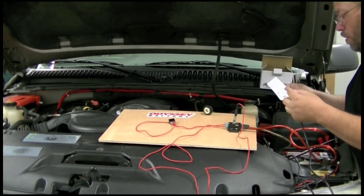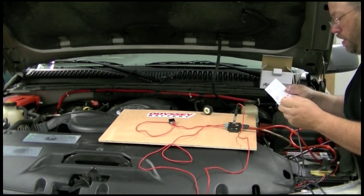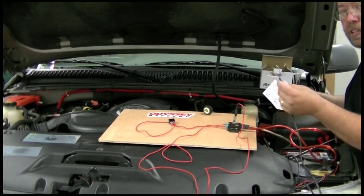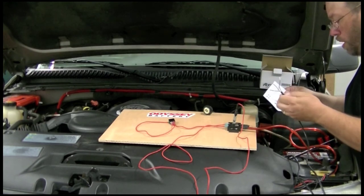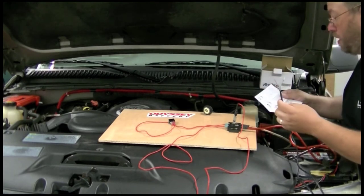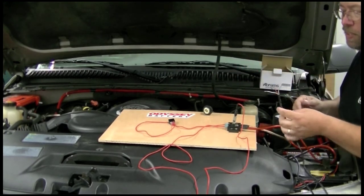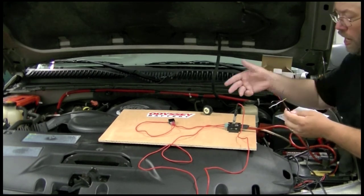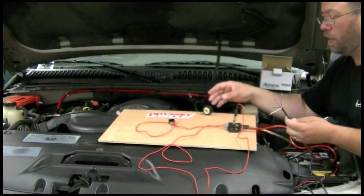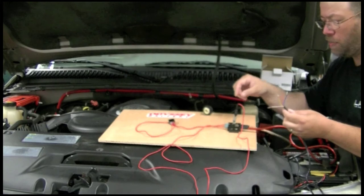The black wire is negative. The blue wire is the pattern switch, which we'll cover in a second. Yellow is the synchronized function, which allows you to wire to other lights and have them all synchronized and flash exactly the same. The red wire is positive — you need to add a two-amp fuse to it. The white wire is a stop-turn-brake steady-burn option. On the steady-burn option, the amount of light from the LEDs decreases after about five or six seconds — either to 40 percent or by 40 percent — to extend the life of the LEDs, according to Abrams.